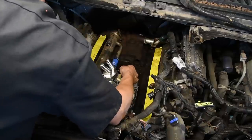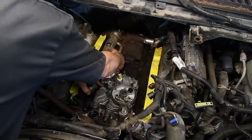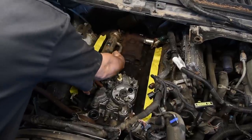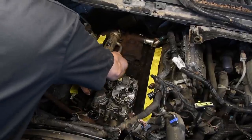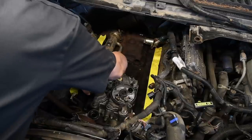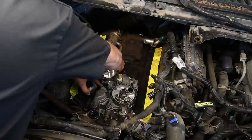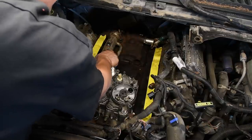Then I hold the cooler back towards the up pipes and I slide the blue hose on. Now, you've got to almost spin it as you're pushing it on. It makes it go on easier. And you're going to keep going until it almost clicks into place. You'll feel it. And then just rotate it a little, make sure it's not on those little detents I talked about.